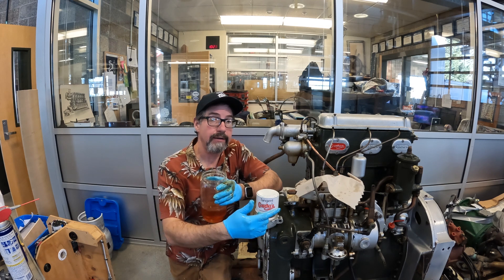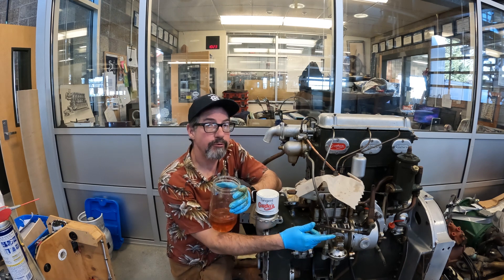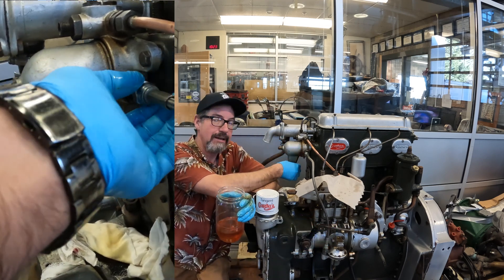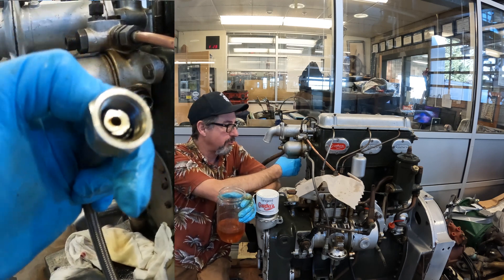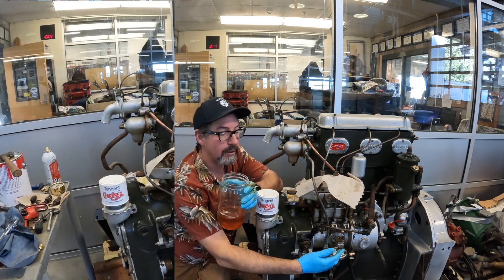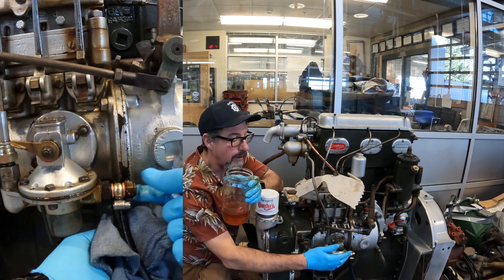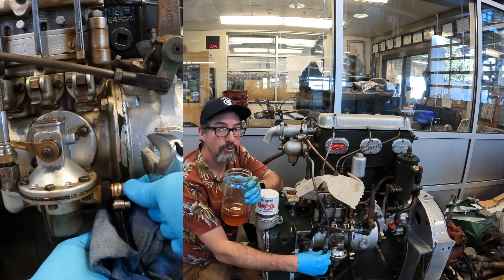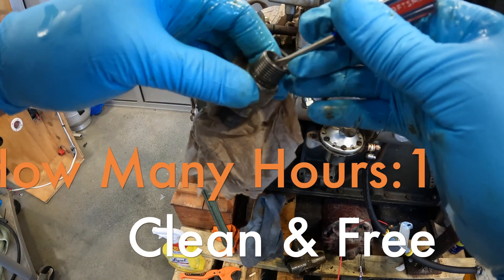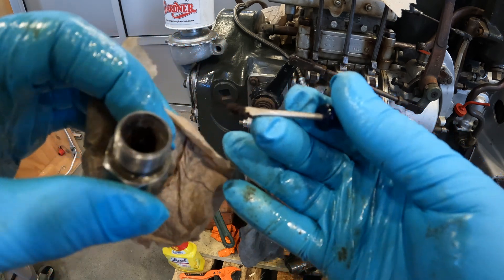On Sunday, trying to get this thing started up and get ready before Sam comes Wednesday, I put on the fuel filter, made a little temporary bracket, and did all that work. I took this apart and of course there's a nut inside — the threads are boogered up — but I want to get this fuel system flushed. I could not get fuel through this line through the pump or anything. I cracked it loose on the input side, made sure my filter was in and out perfect, but still couldn't get anything out. I took it out — it was the check ball, the little check ball for the anti-siphon — and it was completely stuck. The inside was just full of nasty stuff. I got that freed up now.